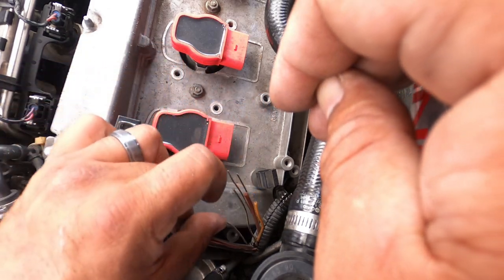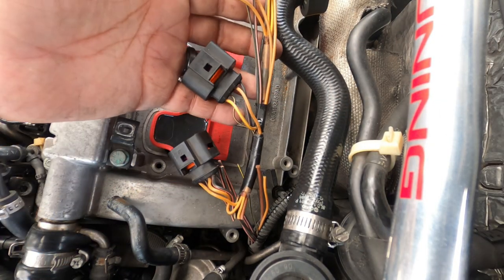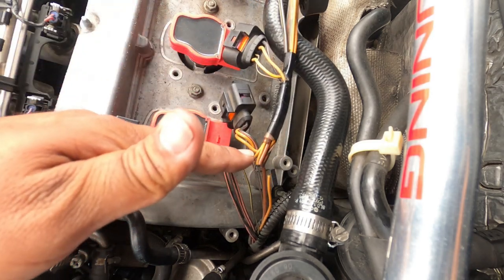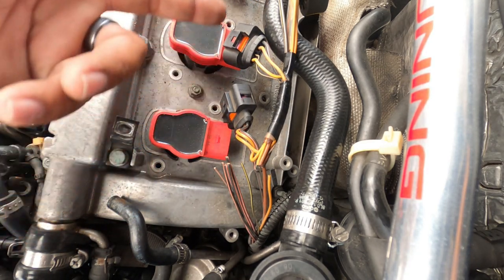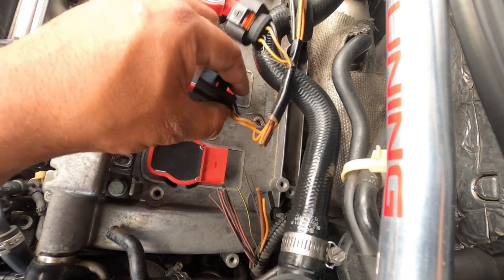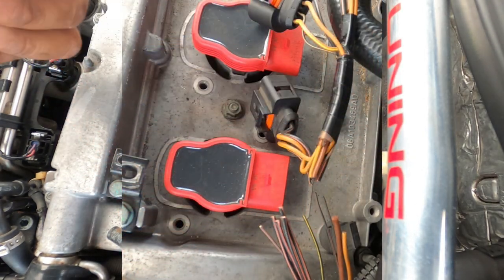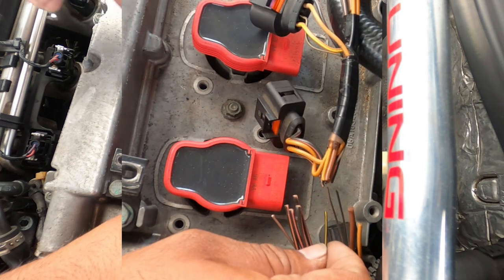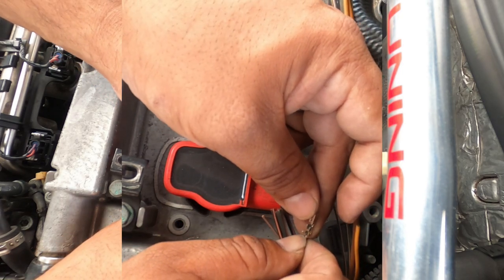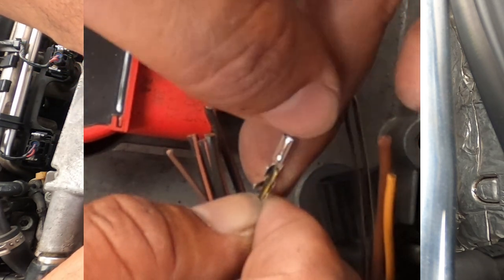First we're going to pin the four cylinders. If you're freaking out about your wiring, don't worry - you have your original pigtail as a reference. Since we cut right at the end, we already have all our wiring here as a reference, so we know which one is four, three, two, and one. Here's your pin - we're going to use our reference for stripping. This is black and yellow, so this is cylinder number two. Strip only as much as needed - see where my finger is, that's how much is coming off. Don't cut too much - it's okay if you don't cut enough, but if you cut too much you've got wire exposed.